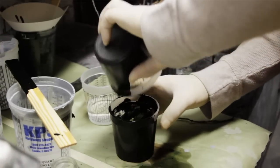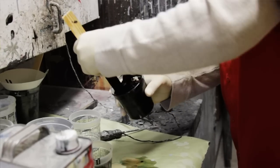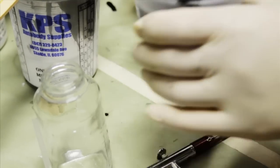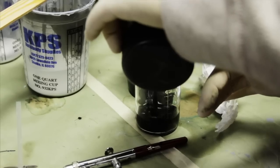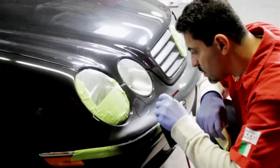My name is William Santiago. I work for Oscar's Body Shop as head body man and painter. Today I was making a formula for the vehicle — getting the OEM code, mixing the paint, and doing the reduction. Basically preparing the part to be painted by mixing all the formulas, preparing the base coats and the clear coats.